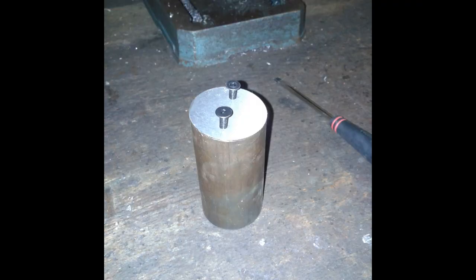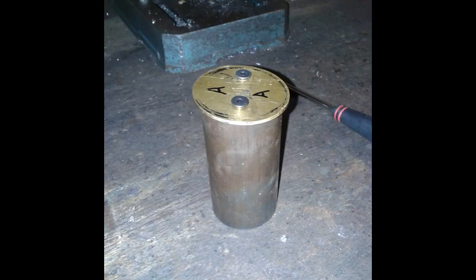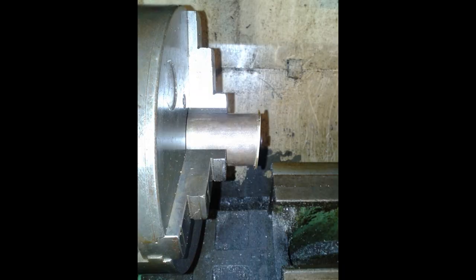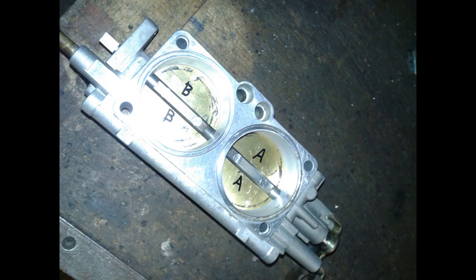I had this large bit of bar from work and one of the engineers there put a bit of a slope on it — maybe six degrees or something — so when the butterflies shut they don't shut completely, you have to make a parallelogram. This bar was put in the lathe with some plates of brass and turned down to exactly the right size, wobbling around because it's not quite flat on that bar, so that made two perfectly fitting butterflies.